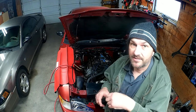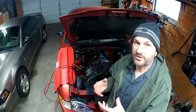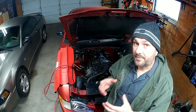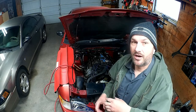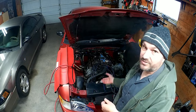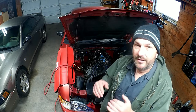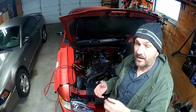So right now you may or may not hear, air is hissing in there. The piston doesn't form a perfect seal on the rings. It doesn't have to. That's kind of what compression is about, or when you do a compression check. There's gonna be some leak down or some blow by. Now in the speed that the piston is being blown down by a combustion event, it doesn't have time to really leak down much. It's blowing down so hard that there's just not time for much leakage to occur. But when you have an air hose just feeding air down there and there's no film of oil or, you know, the dynamics of combustion taking place, yeah, air is gonna leak past all the rings into the crankcase from the combustion chamber.